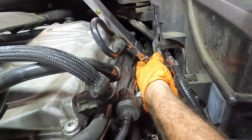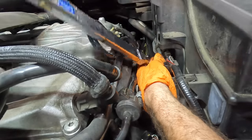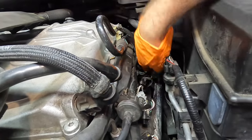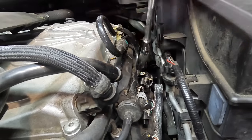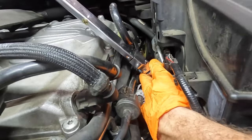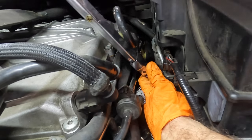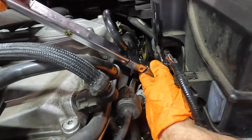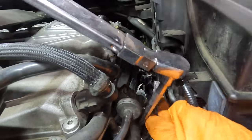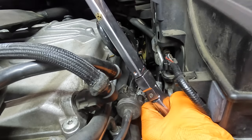That was torque wrench slippage. Come on, become tight. There we go, clicks. Okay, that's four plugs installed and torqued. I forgot if I torqued this one or not, so I'm just going to do it again. And the survey says — I must not have because it's turning. I was distracted and I walked away and then I forgot where I left off. And to go back and recheck — fix.